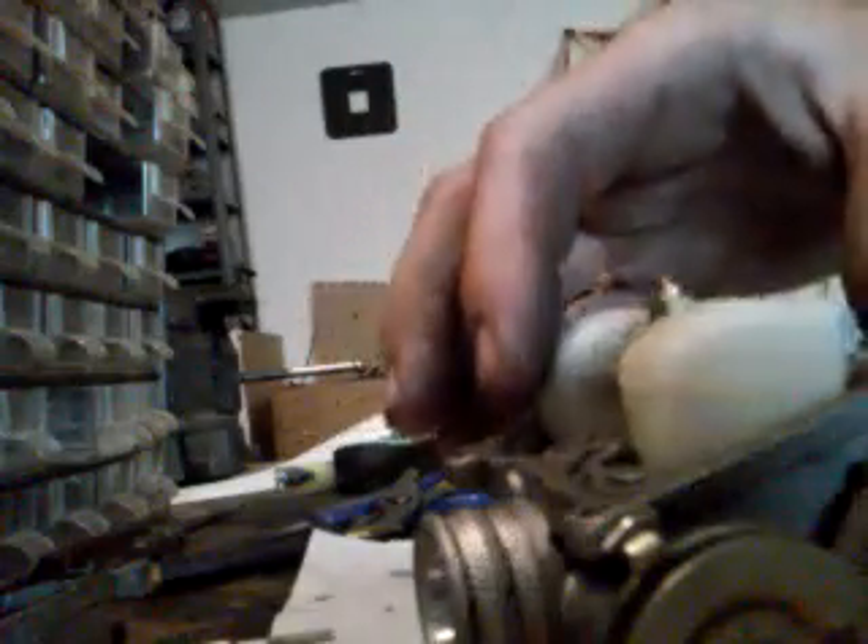I've cleaned off the edges with my little Dremel and brush. I cleaned both jets. My float seems to be good so I'm not even going to mess with it. I'm about to put this puppy back together and get some fresh gas in her today, hopefully send it down the road. I do need to find a couple of springs. This is actually a little fuel pump here and it'll shoot fuel through there. Anyway, we'll put it back together — and that's the carb job.